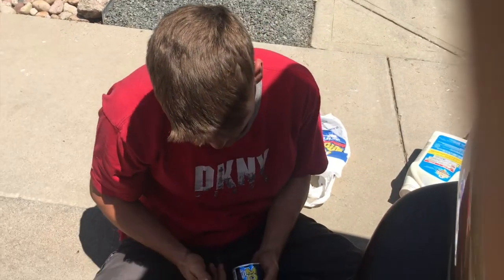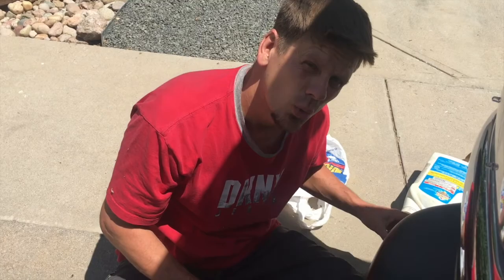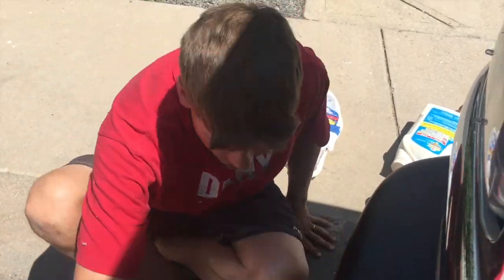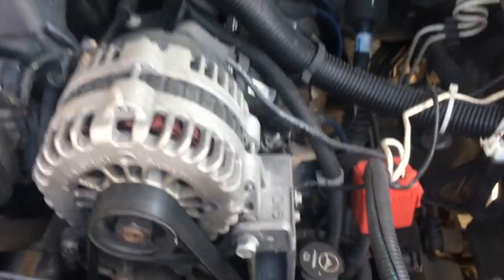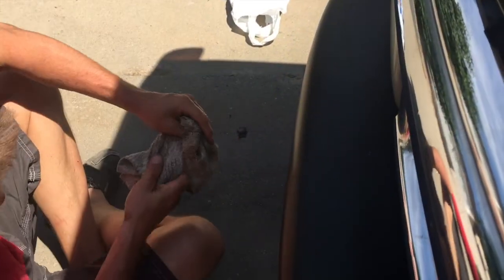Here's the MOA, and I love putting this in every oil change. I had a lower-end knock on this truck and we changed out the knock sensor, which meant basically taking all of this apart and getting down to the bottom of the V8 block to pull out the knock sensor. It still has an issue at times, but that's what normal 5.3 Vortecs do.